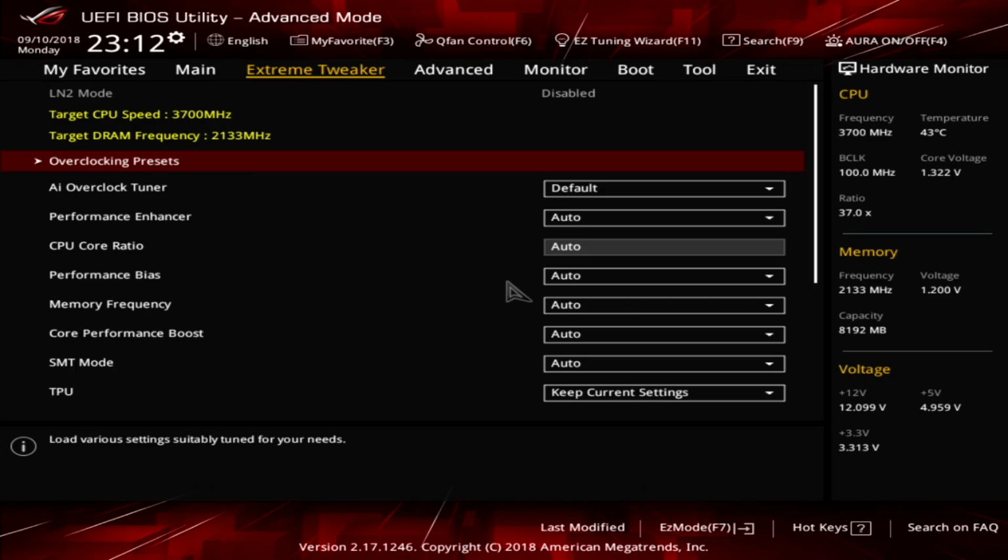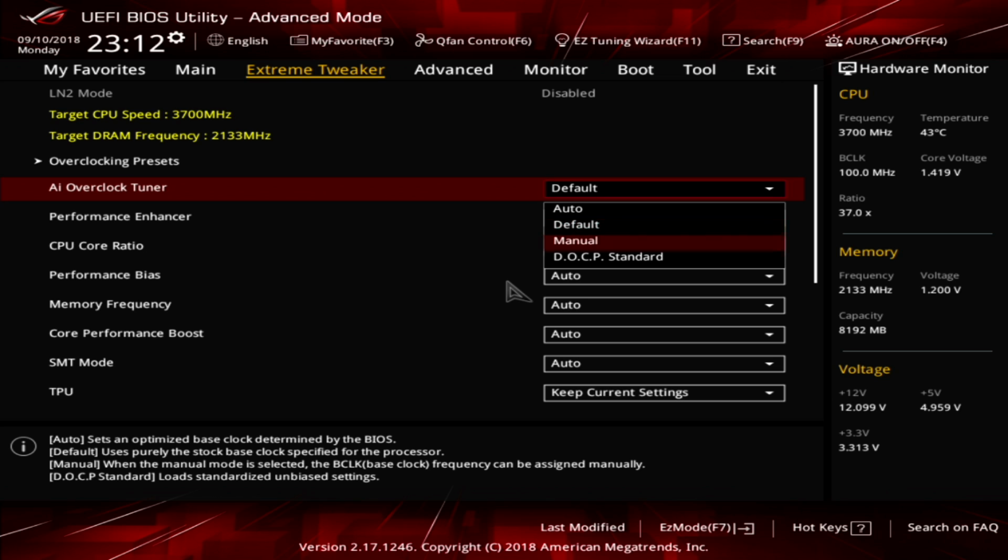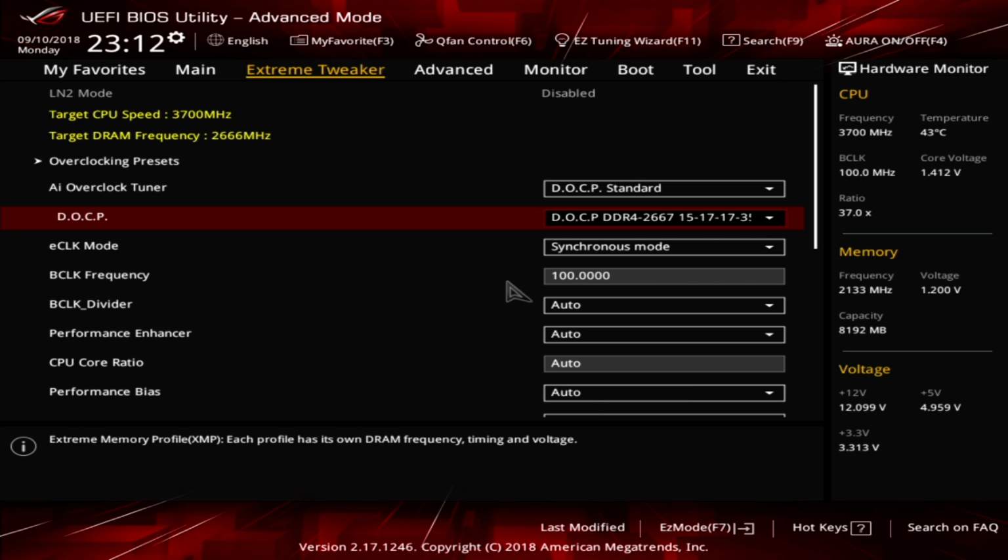Now, continuing in the theme of overclocking, one aspect that a lot of users are definitely concerned about when it comes to AMD series motherboards is how easy the overall experience is going to be when it comes to DRAM overclocking. And thankfully, with our series of motherboards, you're going to have an exclusive option called DOCP memory profiling. This is an option built inside the UEFI BIOS, which allows you to easily and effectively load the timings, frequency, and voltage for your XMP enabled memory and automatically apply them in the UEFI BIOS so you can maximize the investment that you're making in your DRAM.